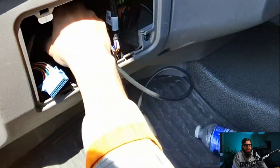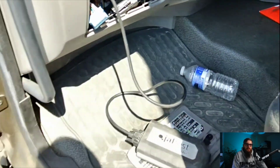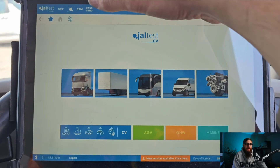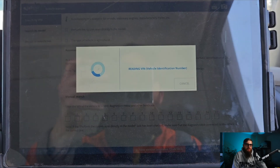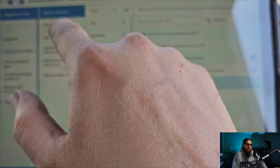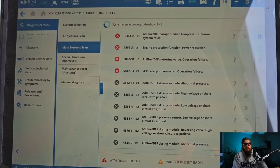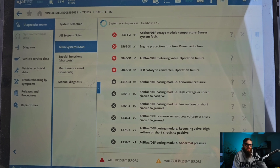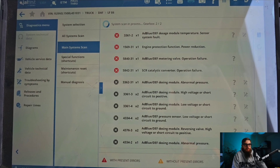We can get started by getting the interface connected to the truck. You can't beat two OBD plugs to confuse people, and with the interface communicating we have the hard job of pressing VIN identification and main system scan to identify all the diagnostic trouble codes in this vehicle. Fortunately we don't have 35 plus ECUs to wait for on this Euro 6 LF, so we can just deal with the active faults straight away in ECS DC6, which is our engine and AdBlue ECU.